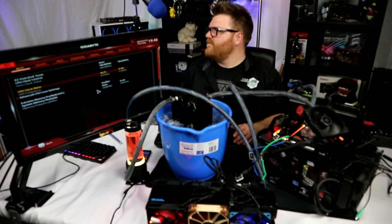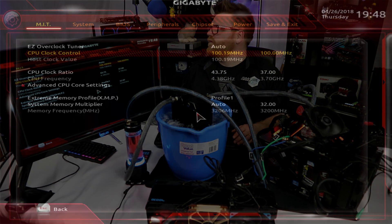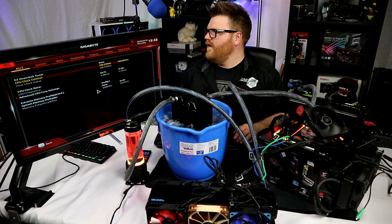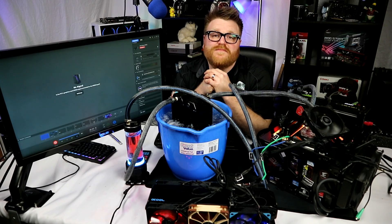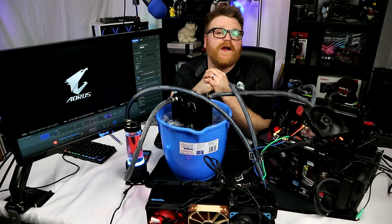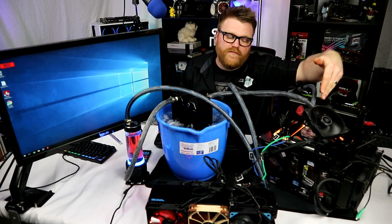What we did better with was 3.75 and adding base clock — CPU clock control — at 3.8. Anyways, if I can't get 2,000, I'm probably going to pull my damn hair out. But you got to do what you got to do — you got to try, you got to achieve your goals. It does seem like temperatures are actually the limiting factor here. I have a very good VRM on this motherboard with heat pipes, and I've got a fan blowing directly at it.